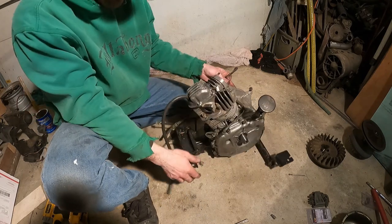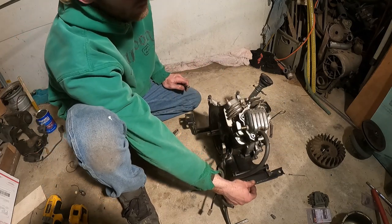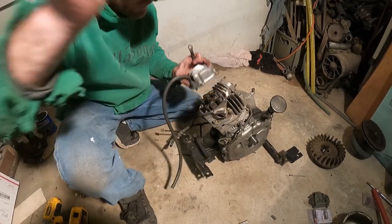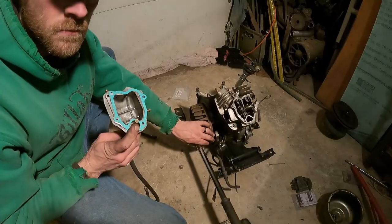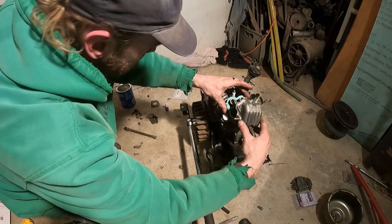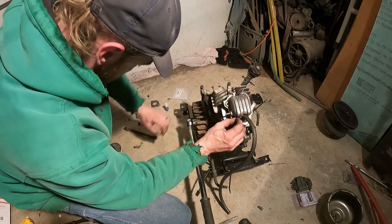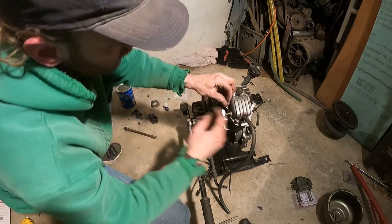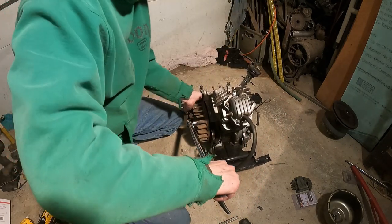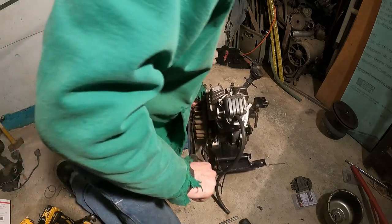And then we have our engine like a complete engine. We'll throw our clutch and our flywheel on here. Woohoo! Let me go get this adjusted. Okay. Gasket. Valve cover. A little Loctite on each one of those. Get these on. We are in business. Flywheel bolts. This one here is 54 foot-pounds. And same with the clutch on the other side.